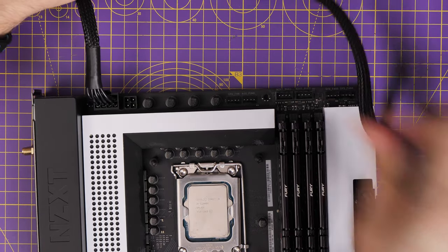If your graphics card needs three 8-pin connectors, you'll have to use the pigtail daisy-chain cable — plug that into the PSU end and you'll have two connectors available. It won't look as neat but there is enough for most modern graphics cards. Plug your graphics card into the top PCIe slot on the motherboard for best performance as it gives you the most CPU lanes. Run the cable from underneath and plug it in, making sure you don't put too much tension on the cable and that all cables are pushed together and fully seated.